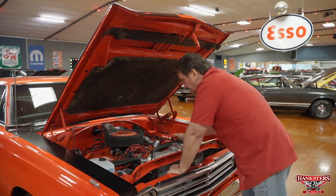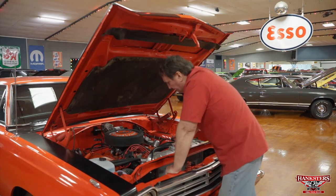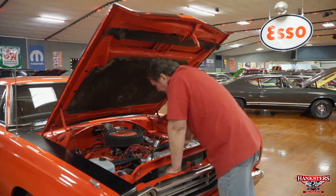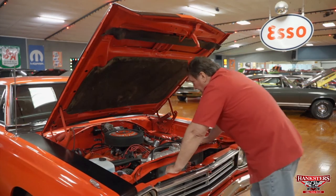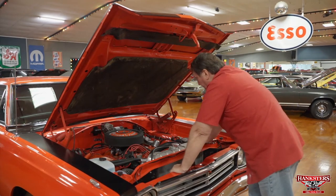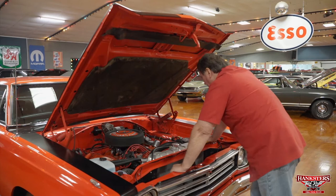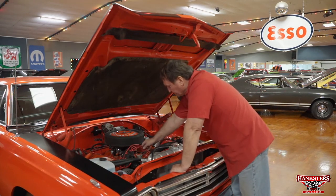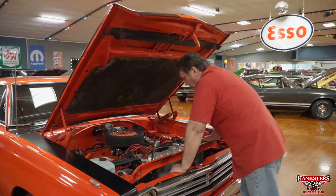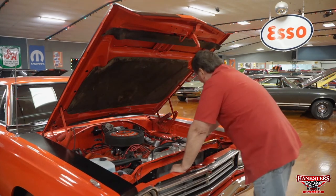The engine is the correct motor for this car. You can see everything's been done freshly — the motor's been out, everything's freshly painted. New water pump. It has the original cast iron intake manifold, a Carter carburetor, the original cast iron exhaust manifolds, the original Presto-Lite distributor, and a set of aftermarket silicone plug wires. Vacuum advance is still hooked up, and there's a new battery.